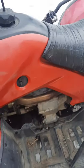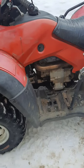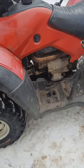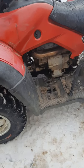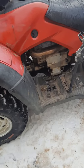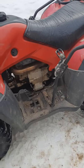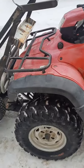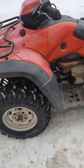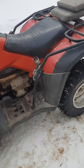It was a mechanical issue inside. When I got in there, someone had obviously been in it before — the little shift fork ratchet assembly had the end busted off. Looking at a parts explosion, I figured out someone had been in there and lost the shim that's supposed to go behind it, so it was riding right on the end of the shift fork and snapped it off. He went to Honda, got a new one, and said he'd sell the machine to me cheap. I said okay — it's right up my alley; she's a little rough but that just means I'm not scared of putting scratches on it.